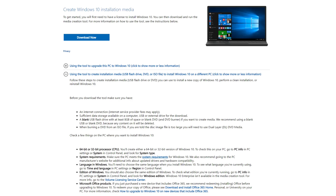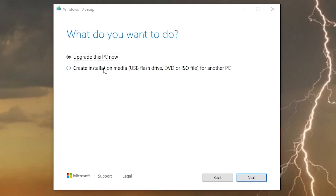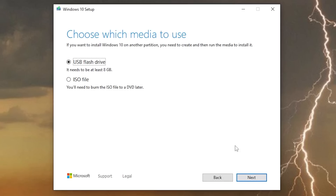Installing Windows 10 is very easy. You go to Microsoft's website, they have a media installation tool — you download it, plug in a flash drive, and it will copy Windows onto that flash drive. You pop the flash drive into the PC, power it on, access the boot menu — maybe F11 or F12 when you first start it up — pick the USB drive as the boot device, and go through the Windows installation. Pretty simple.